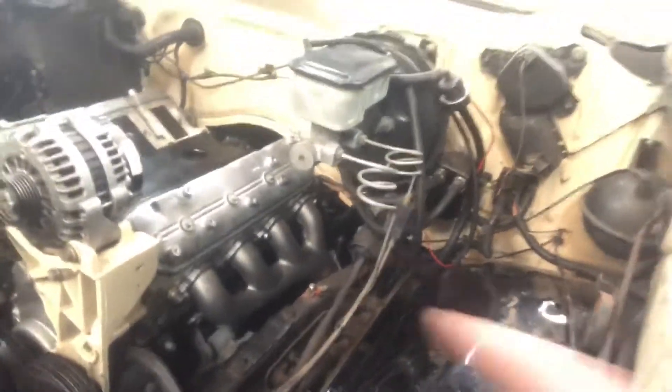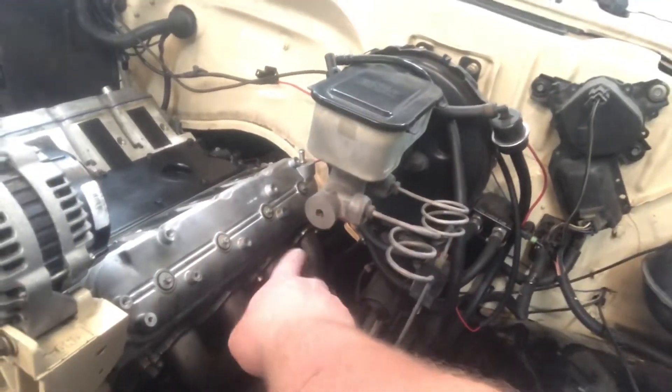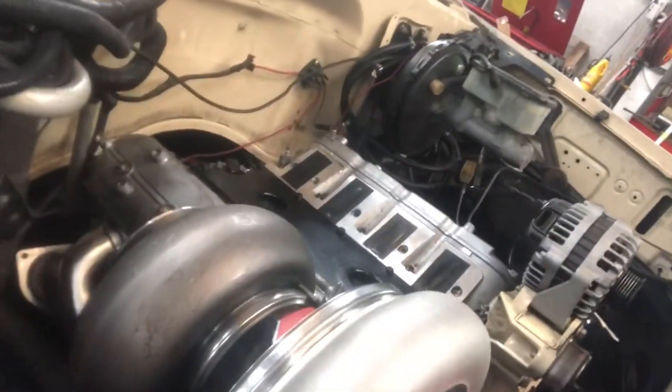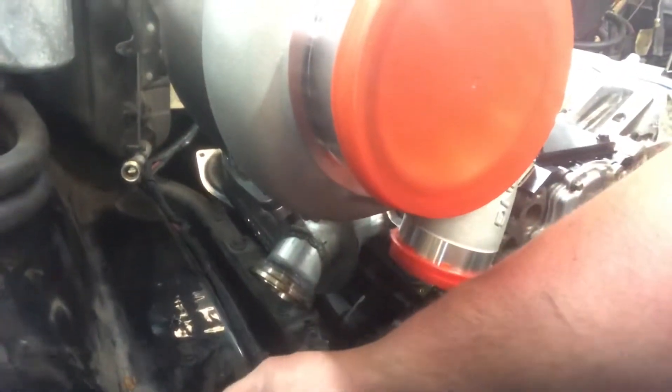What I'm going to do is both of these — this manifold on this side has that doghouse little flange on the back, and so does this trick manifold. I just really like V-bands better, so my buddy Taylor's going to help me do that. And our wastegate down here at the bottom shoots directly into our inner fender, and I'm just not a huge fan. So I'm going to turn that up a little bit, see if I can kind of avoid cutting the inner fender out for that. I can't weld, so that's a weak point for me.